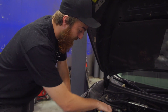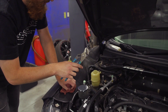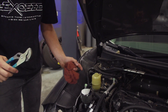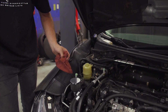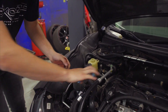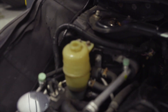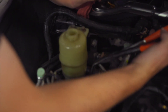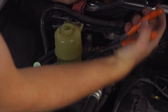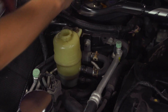The next step is to remove the spring clamp from the top hose and these two 12mm head bolts. This will allow us to swing the reservoir out of the way and then get the last clamp and hose off without making a giant mess. If you have trouble getting these hoses off — which I don't imagine you will, but sometimes you do — give them a little rotate and that'll loosen them up.